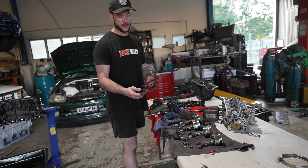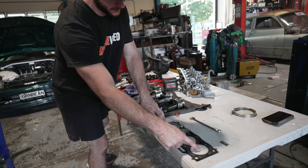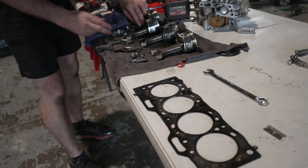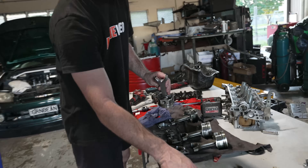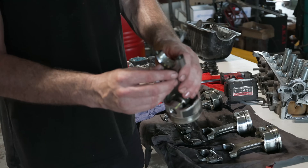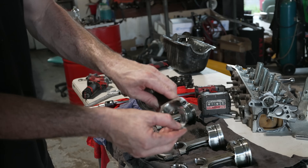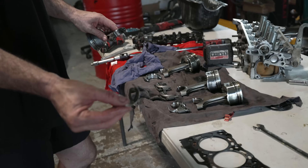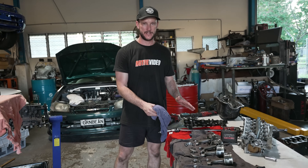So to bring it all together with the head gasket — we've got cylinders one, two, three and four. Cylinder two, the paint's lifted. Bearings one, three and four are still in pretty good nick. Cylinder two has had the higher cylinder pressure or detonation and that's trashed the bearing. I think if we kept driving this it would have done even more damage. So this isn't too bad — we can rebuild. Put another set of bearings in there.